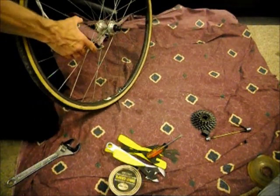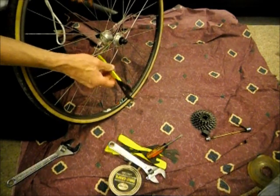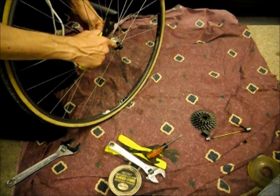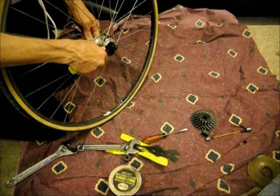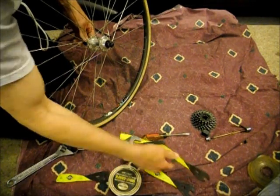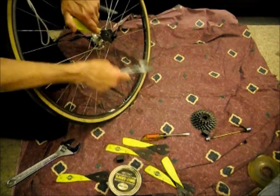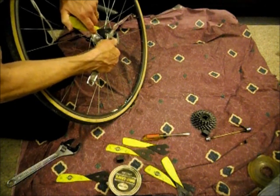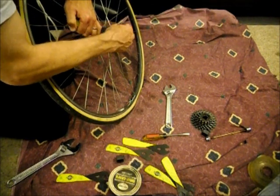What I'm going to do is pull off one side — I'm going to go with the side that the freewheel is not on. I've got cone wrenches here, which are very thin wrenches, very helpful because there's a little notch on the cone that a fatter wrench like a crescent wrench is not going to fit on. The 16 doesn't quite fit — it's too big — so let's try the 15, and that's a nice fit. Just loosen the lock nut and get the lock nut removed.